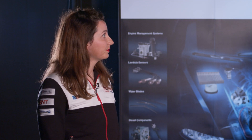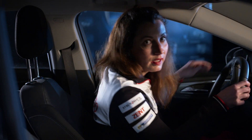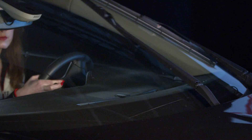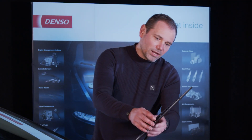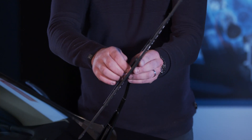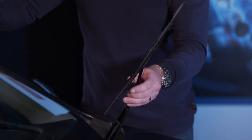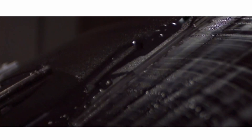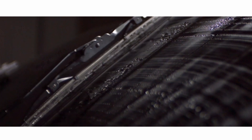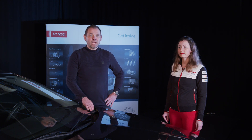Shall we have a look at the car? The wiping system is in constant use and has a lot of moving parts. When the connection between the wiper blade and the wiper arm becomes flimsy, or when the curvature of the wiper arm does not follow the exact curvature of the windscreen, it has a negative impact on the wiper blade mechanism. This can even cause the wiper motor itself to break down, which is a very costly repair. Therefore Denso advises to always replace the entire wiper blade and not only the rubber itself.